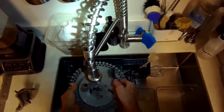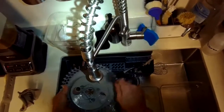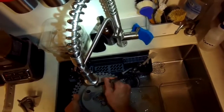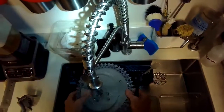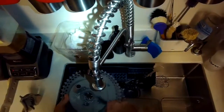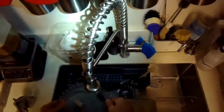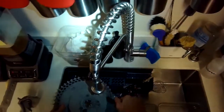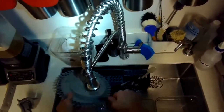There's the upper filter assembly, and this is the sump cover — getting that clean — and then there's another filter above this that we also clean up. But the main culprit was that silver metal filter, which was really almost 100 percent blocked.